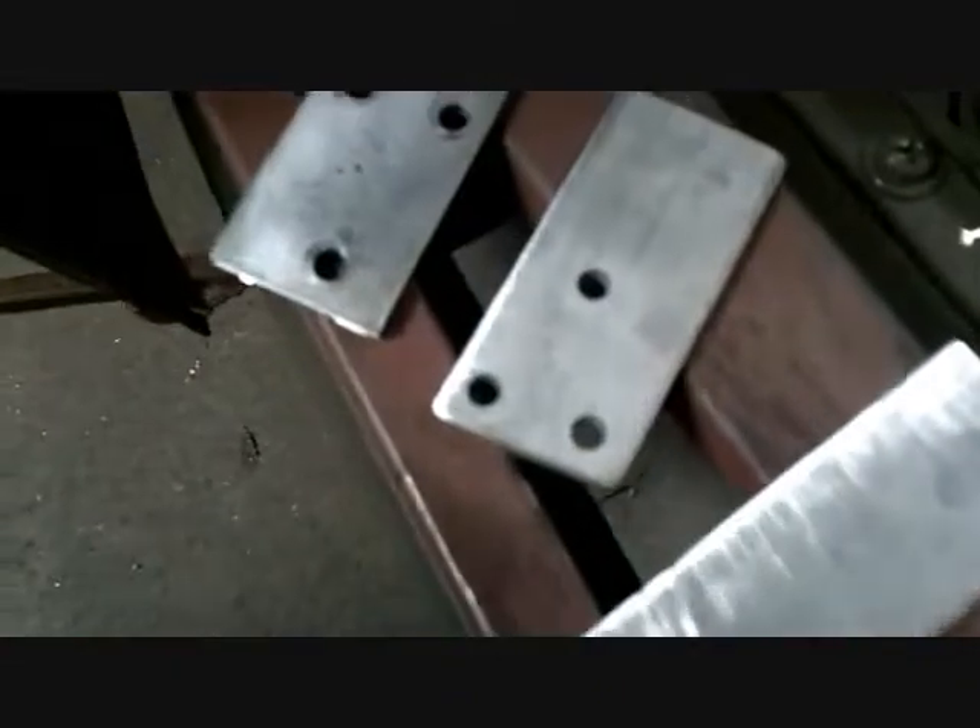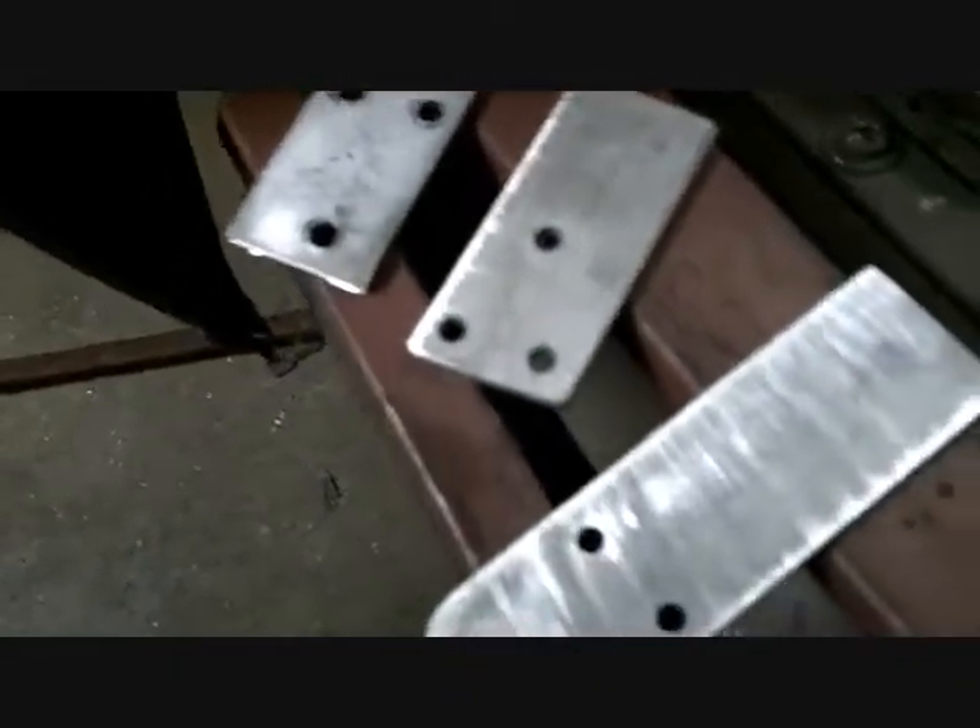I'm going to clean up a few things, probably sweep the floor — it's a mess — and go in because I have to sleep a little more today. I broke the welds on the tilt for the pan, so if I cut this weld, which it is now, I can actually tilt the firewall back and forth. I did find out that it's not even a quarter of an inch tilted forward too much, and I have to bring it down.